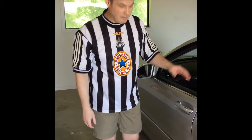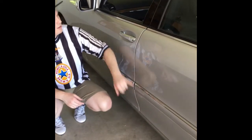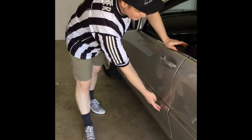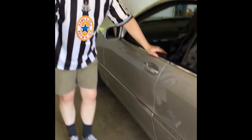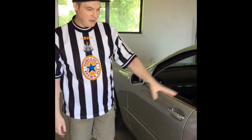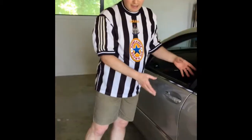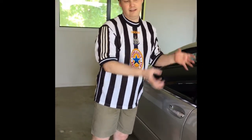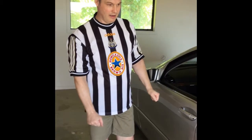So hopefully that's a very quick thing to do, because if the air is not leaking from the seats, then it's going to be leaking from something called an actuator, I think. There's a little device in the doors that controls your central locking. The vacuum pump sucks air in and out, pulling the locks up and down. But I suspect that is a very complicated system, and if one of them is leaking or broken, then you have to take the entire door to bits, take everything out, and that will be an absolute pain.